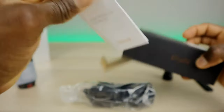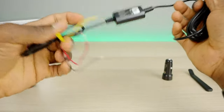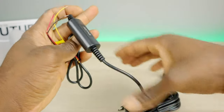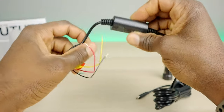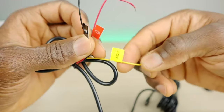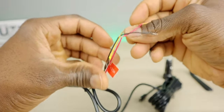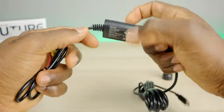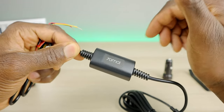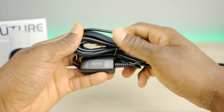The hardwiring kit comes with a user's manual. It's pretty straightforward — at the end you have a USB-C for the dash cam, plus a regulator to make sure the dash cam doesn't drain your battery. You have accessory (yellow), voltage for battery connection, and ground. The regulator manages the supplied voltage to protect your battery. This is likely a separate purchase but a great option if you want parking mode.